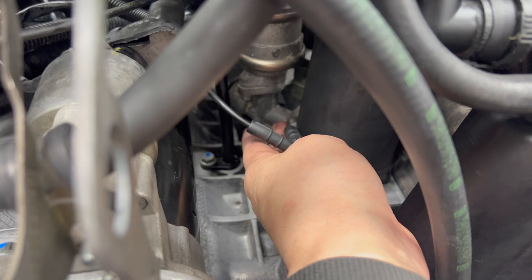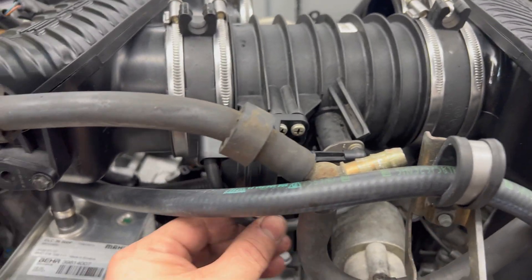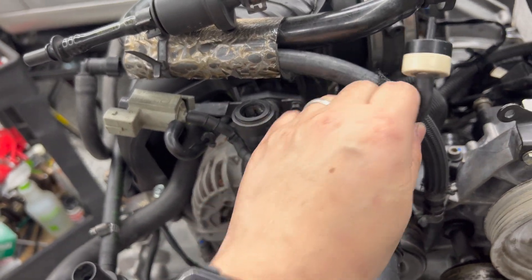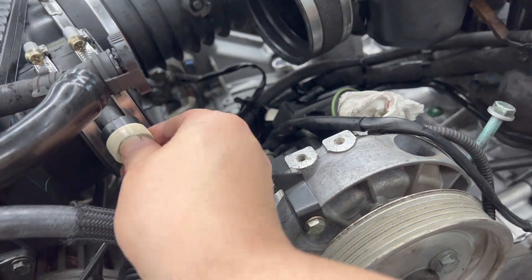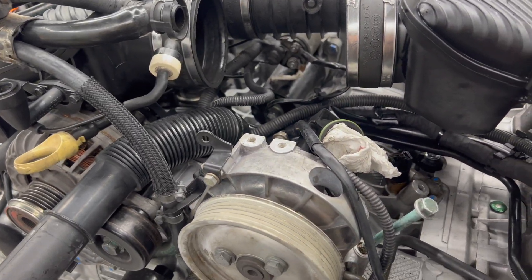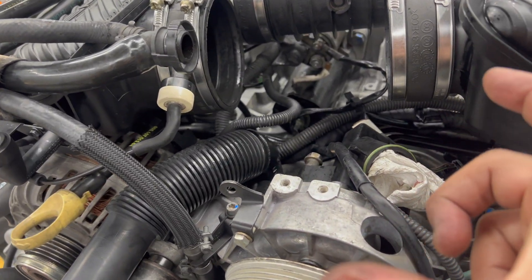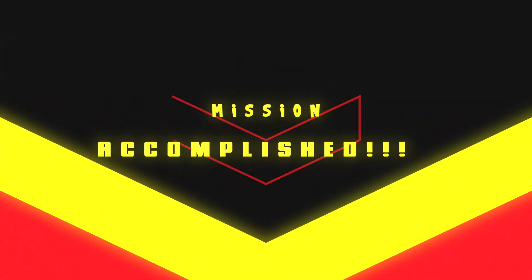I said I'd show you the vacuum system and how it's run, so here we go. Starting down here — from the canister it's splitting off from the changeover valve, and this one here is going all the way across. It's like this one comes from the changeover valve in the front which is then controlling the check valve that goes into the neck here. I should go ahead and connect that now since I'm looking right at it — just like that. It took a little figuring out because some connectors were not connected when I took the engine apart. I only had to replace one single length of vacuum tubing, so we're good to go.